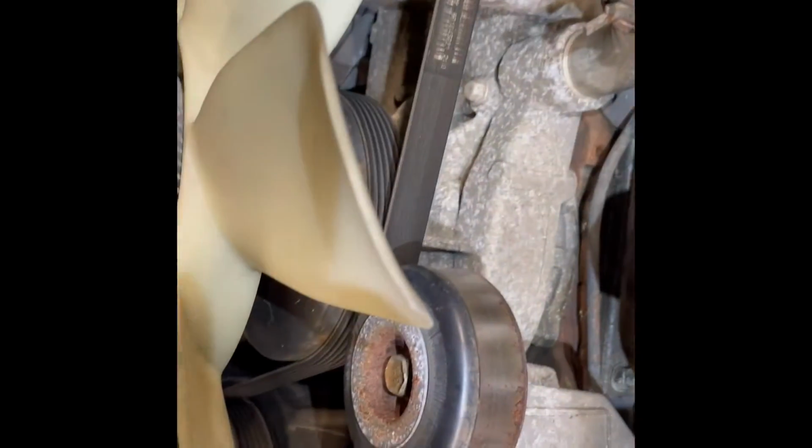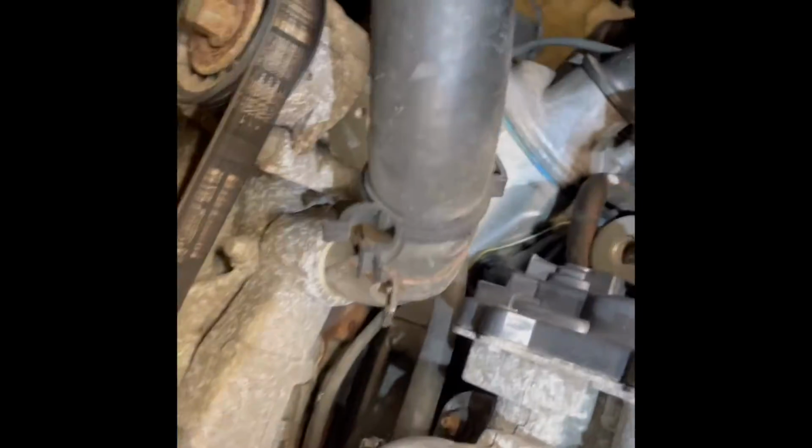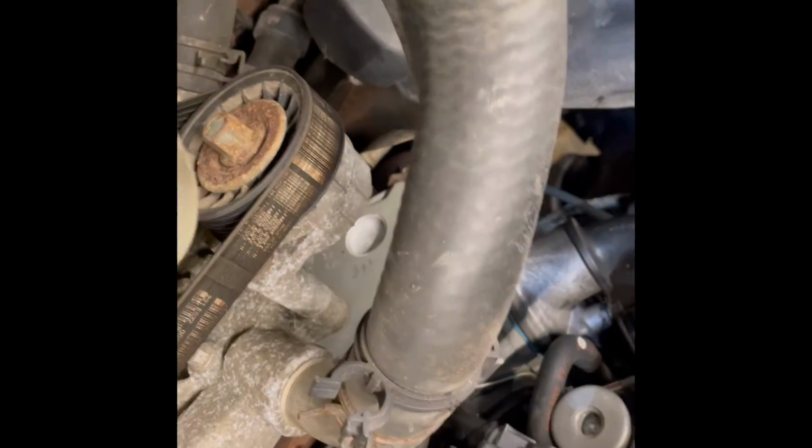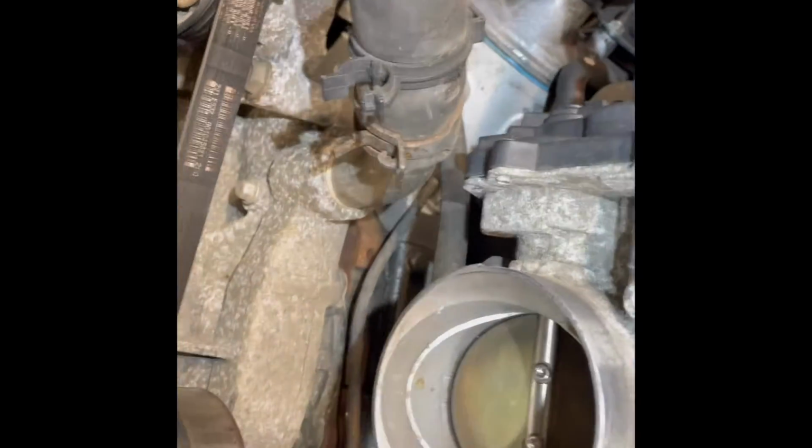All right, guys. So now, like I said, we're gonna do the drive belt right now. Looking a little crusty. Routing seems simple, so tension is right here. We're gonna do the tensioner, take the belt off. To access that, we gotta take this panel off. It's 4 clips, and then a couple of screws holding it up. And then we have a nice little hive right here.